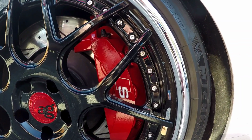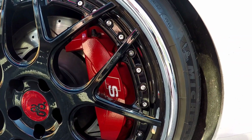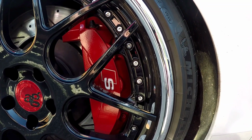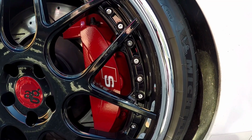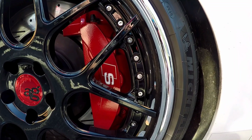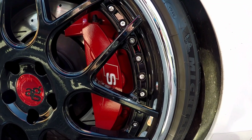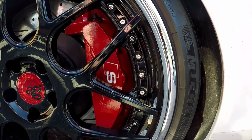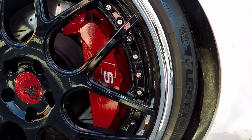You're gonna want to degrease everything. So brake cleaner, I used brake cleaner with Purple Power mixed. So I'd spray it with brake cleaner to get all the big stuff off, and then I'd take Purple Power with some hot water. I'd spray the Purple Power on there, and then I'd scrub everything with a toothbrush. And then the stuff that wouldn't come off, I would take a piece of sandpaper to, and I'd sandpaper it.